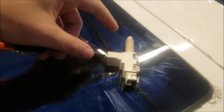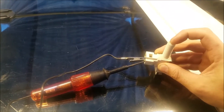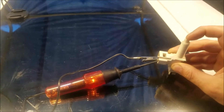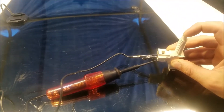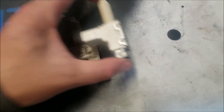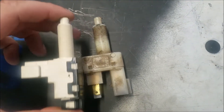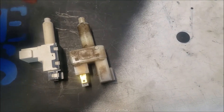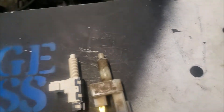We got the new switch in. Now it's lit up — basically this will be pressed up against the clutch pedal, and when you step on the clutch pedal it releases, and now it's lit, meaning the contacts have been completed. The first issue I found is this is a larger diameter than the original, so I'm gonna cut this off, drill it out, and tap it for this one. That worked.